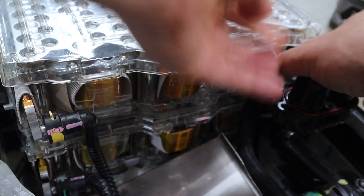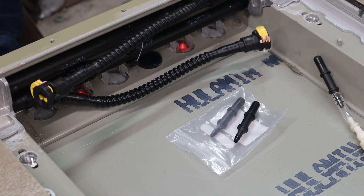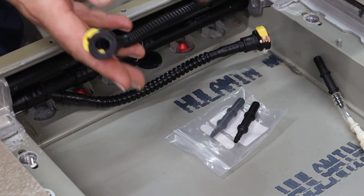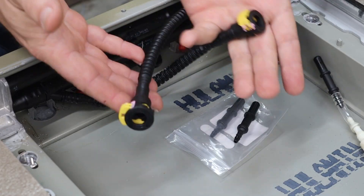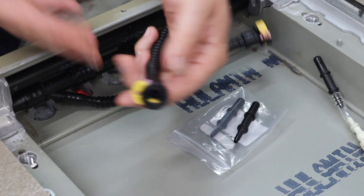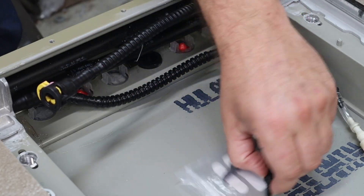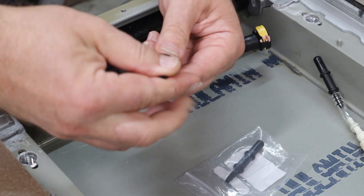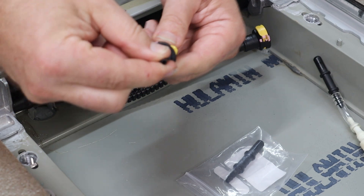After this, I put in all the cell modules except one and connected their coolant lines. Now, before I install that last module, what I'd like to do is test the cooling lines. I've got these two battery coolant lines right here, and all the rest of them are connected, so these two are the beginning and the end of the entire system right now. These are essentially just 5/16ths quick-connect fuel lines — standard parts. So I got some little plastic connectors that match, slide it all the way in, click that shut, and now I've got a connector.